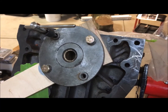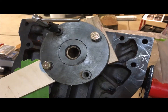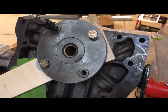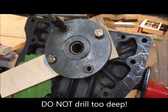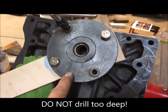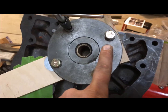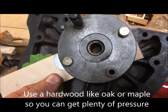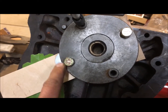I've drilled the holes and now I'm tapping them out. No one's going to confuse me with a true metalworker, but this is actually not that bad. I very carefully measured my bit and marked it with tape. The real trick to this job is to lock the block in place — when I wasn't working on a hole, I put an extra bolt through. I've seen it done with thick copper plates, but I don't have any copper, so I just used wood.